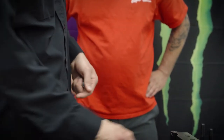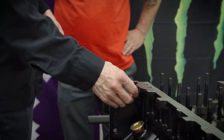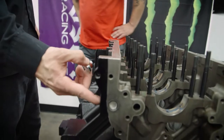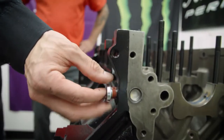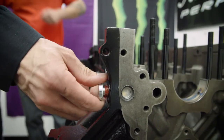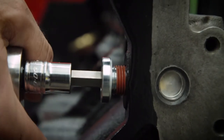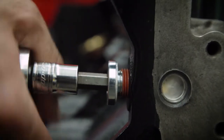What we're looking at here is one to block off the oil galley there, and we got one more for the oil galley in the front of the block. That's an area that if you choose to prime the engine ahead of time using this method, you would pull this one out to be able to access this area here.